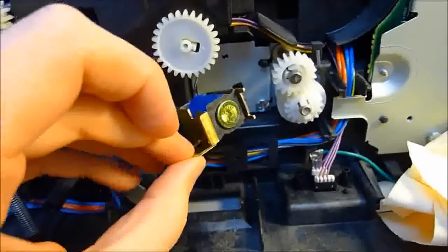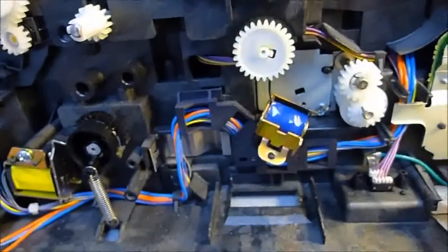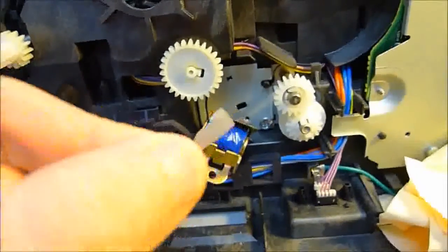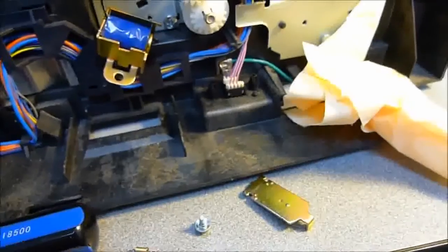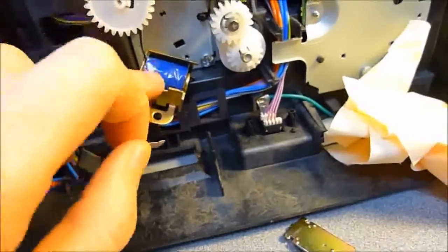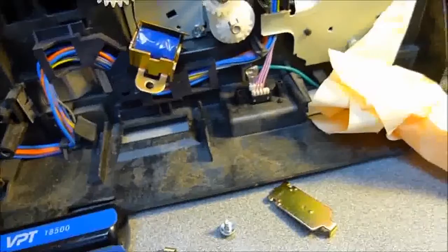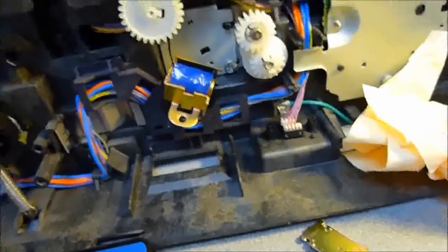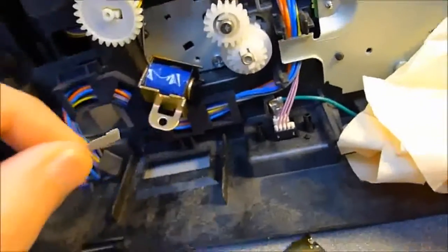Now while I was doing this, I looked online and it seems that contrary to what I said previously, what we actually want to do is take some kind of piece of plastic or some magnetic-resisting material and stick it back in place where the adhesive used to be. The reason is that a lot of times people just clean it off and don't replace it, and then there's a problem with residual magnetism from the solenoid — it fires and causes the metal to remain slightly magnetic. All it takes is a microsecond of delay and the printer will jam. So I'm going to stick a little piece of tape back onto there.